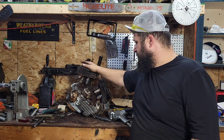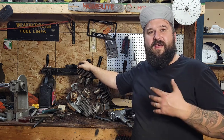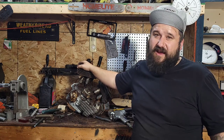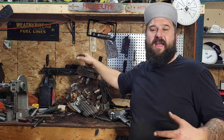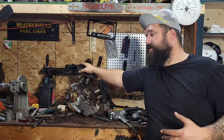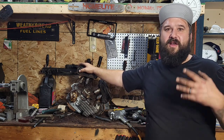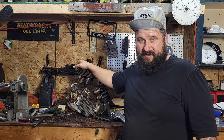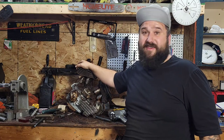You win some, you lose some. Maybe using that puller wasn't the best idea, but at this point these cylinders are so trashed - they really are in horrible shape. Yes, you could have them bored, but I've talked to a few guys who work on these and they said it's not worth the time to bore, sleeve, and put new valves in old rusty cylinders like this - because good cylinders are still available, repo cylinders are available. It's a shame - I really wanted this thing to be complete the way it was.